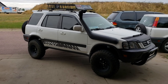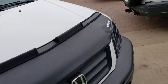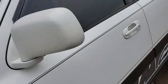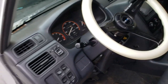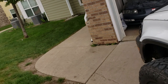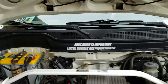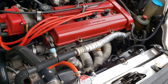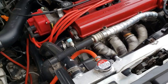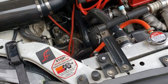This is my second setup — I'll explain my first setup that was a little bit lower with almost all of the same parts. One thing I learned: trust me on this — if you really want to build a first-gen CRV and have it reliable, fun, and with good flex, do your springs and struts first. Do OEM, do aftermarket, do whatever you want, but do those first. Go with off-road struts or at least OEM. I did sport struts the first time — it wasn't horrible, but it just wasn't best for off-road, and I had to use much bigger spacers.